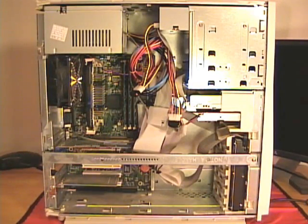The SEC cartridges are not manufactured anymore, but you may still find these processors in use in some older Pentium 2, Pentium 3, and AMD Athlon computers that use the slot 1 or slot A form factor. I'll perform a quick removal of an SEC processor so you can see what that looks like. To remove an SEC cartridge you generally release or bend the holding tabs away from the processor and then pull the processor out of the socket.